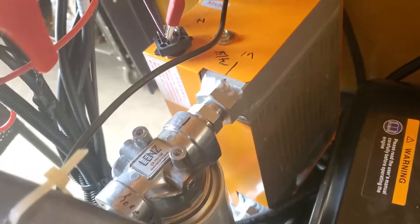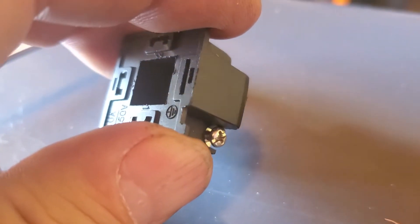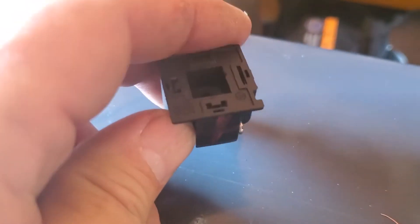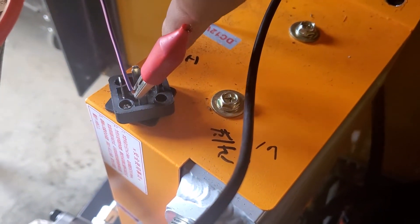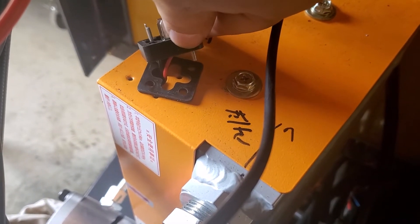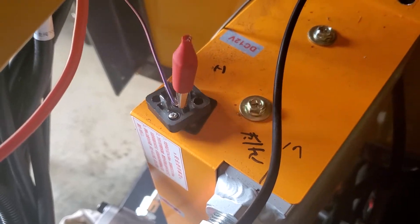I struggled with this for a while trying to get the right pins for the fan on this oil cooler. It has a four-pin DIN connector — you can Google it. This one right here is what we're gonna use for the gauge: one side is negative and the other side is positive. I ended up having to take out the top piece and look in to see what two pins are being used — there's a black and a red wire — so you can see which positive and negative goes where, and it works now.